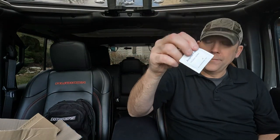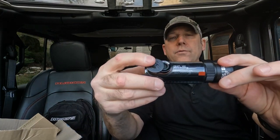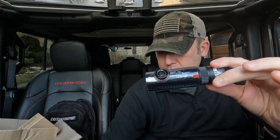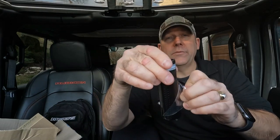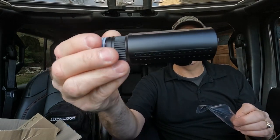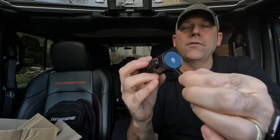We don't need anything else except you do want to take out your alcohol wipe if you're going to be mounting it on the windshield. Now I'm going to be mounting this directly below the other camera so we can do side-by-side testing. Let's get the cable ready. There's a little cover right here — just want to slide that off. You can save it if you want; you really don't need it anymore. That's just to protect the lens during shipping. And then this plastic cover right here, I'm going to peel this off. If you don't peel it off, your camera is going to be shutting down because it's going to be overheating. There are perforations on the camera to allow venting — please take that off. On the outside, there's another plastic cover; I'm going to peel that off too.